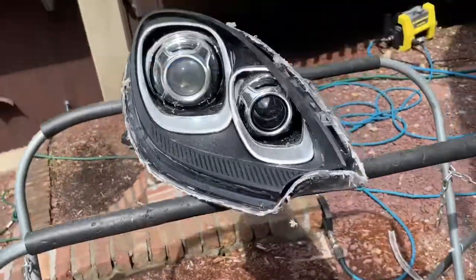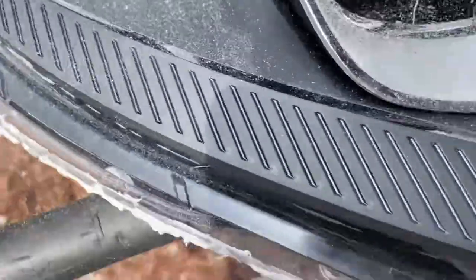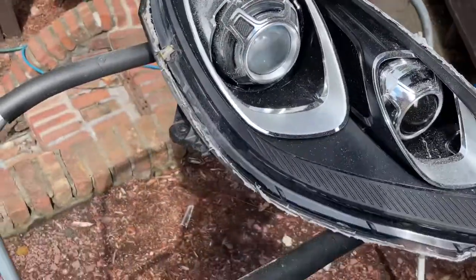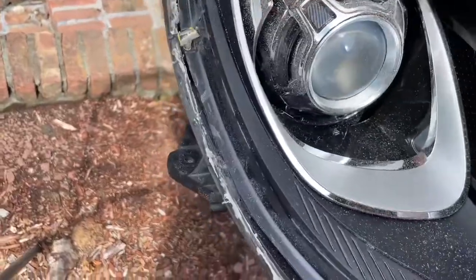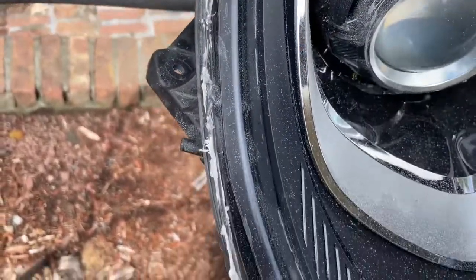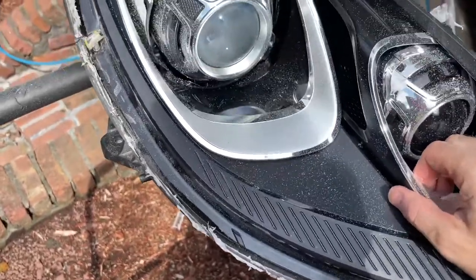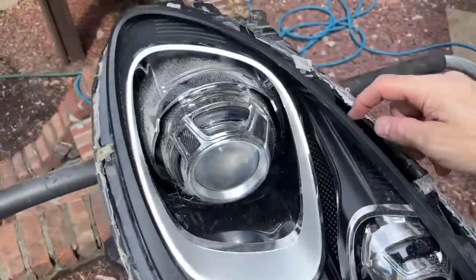By now you're probably thinking I did a lot more work than I had to — and you'd be right. You actually have to cut much lower than I originally showed, right along the edge of the glass, so that you can remove this piece here. When you get this far, you pull it out from the top. I have some tension there coming from this area, and you can see there's butyl that was put in for sealant, adhered to the inside. So I've got to get a razor blade and exacto knife to cut around the perimeter of this whole piece.